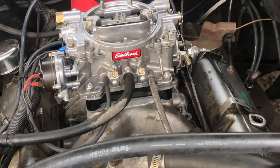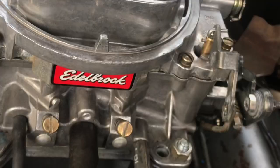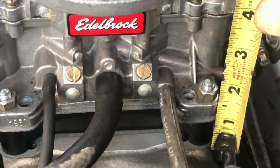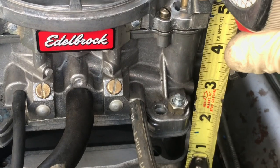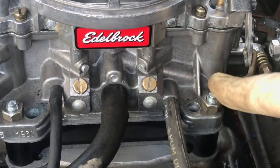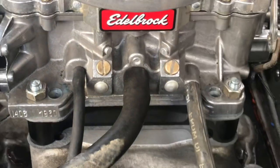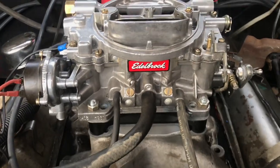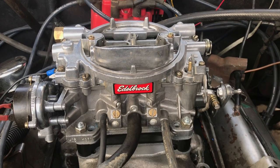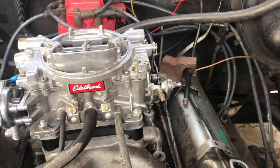What did Uncle Mike teach us here today? First of all, we're gonna get longer studs — preferably studs, but I may have to get bolts. I need two inches sticking up, so I'm gonna give myself another inch and a half — so like two and a half to two and three quarter bolts or studs is what's needed. These are my old 13s; the new hardware had 13 millimeters but these are half inch. I get what you pay for. I can't even get the bracket on, so I'm just gonna idle this over to the parking spot and go to the store.